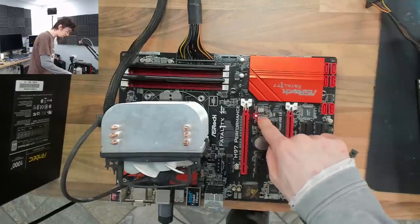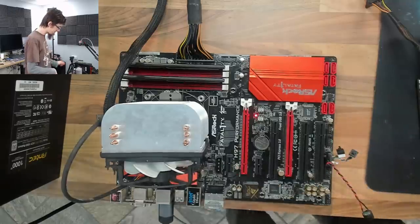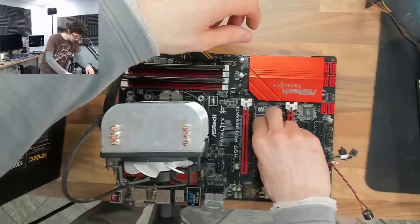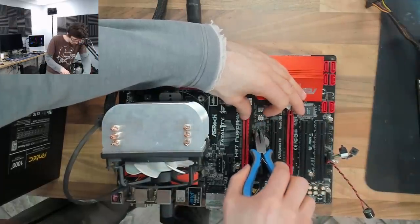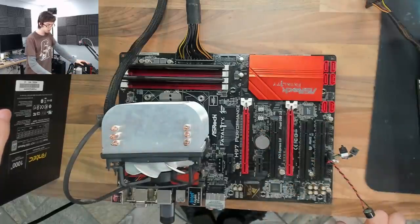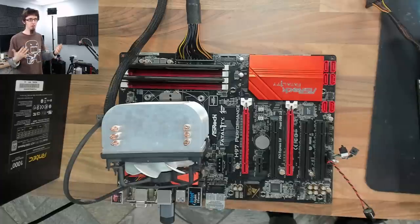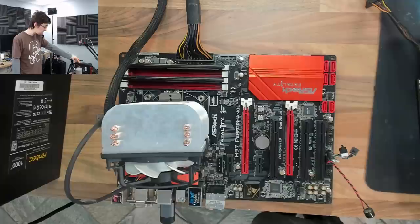I'm going to reflash one of these BIOS chips. Actually, what we haven't tried is resetting the other BIOS chip. I'm going to try switching to the backup BIOS and then doing a clear CMOS. I don't know if this is going to work. The problem with backup BIOS systems is there's never been a standardized system — different brands behave differently. If you haven't seen all of them, you don't know how it's going to behave.